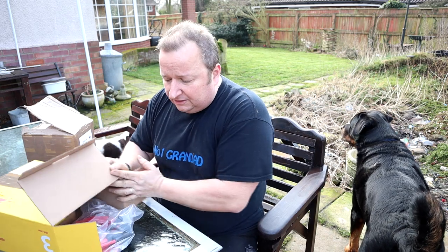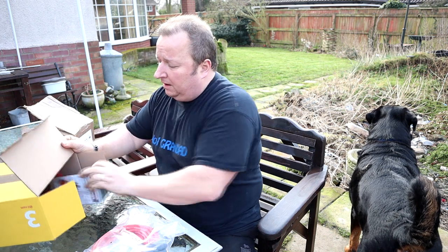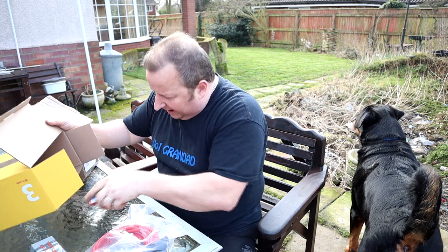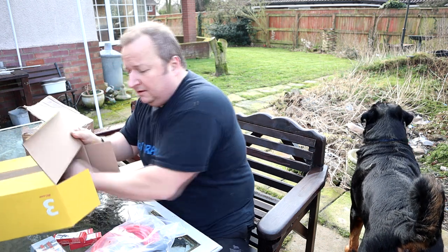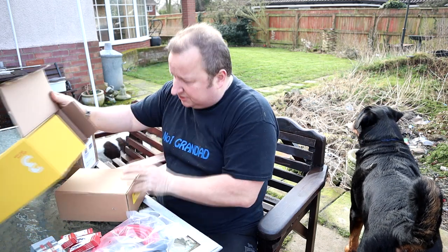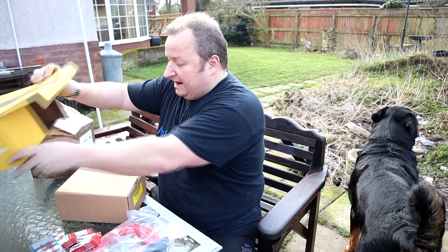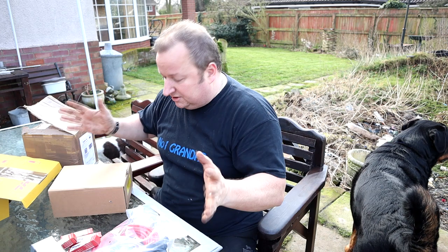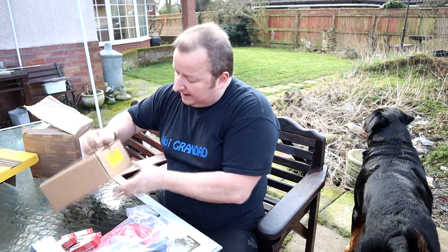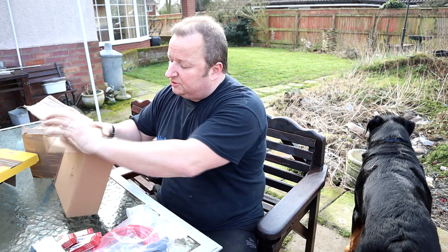Right, so, as you know, I didn't have an ignition system for the Trotter van. Not the new engine, anyway, so I bought this pack off of eBay. It's from AccuSpark, I think it is, and it comes with the distributor, the HT leads, the coil, and also the plugs, and also fitting instructions. So we're gonna have a look at that in a second. But as I say, this is a pre-bought kit. What you get is a Lucas 25D4 side cap distributor.